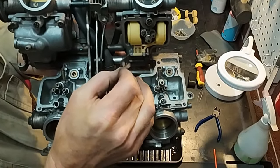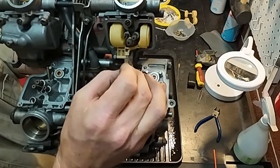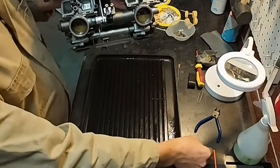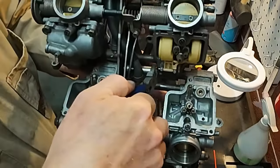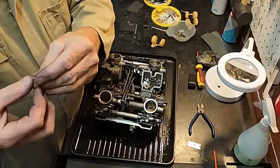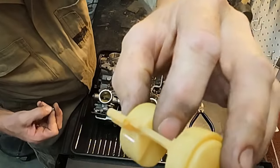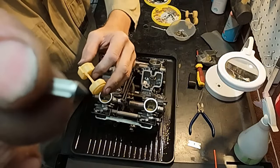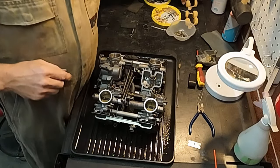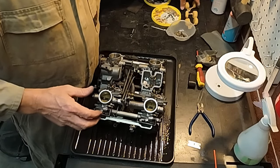There's the pivot. You can't grab that end of the pivot pin because it's not sticking out far enough, and you can't push it because there's a brass rod there. So what you do is put your blade there. This here is the float valve. Don't forget I'm showing you upside down — it rises and pushes this point into the hole to stop the fuel.